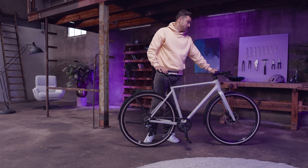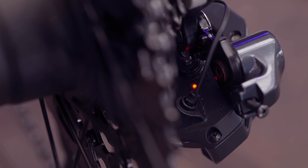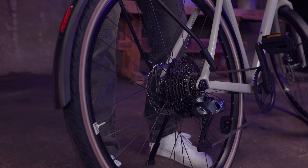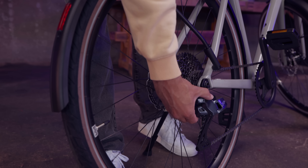If the LED button flashes red, this means calibration was not successful. If this happens, check if the wheel was completely still when the button started flashing — the wheel needs to be still when you start calibrating. And don't forget to check if your bike is on a flat, level surface.